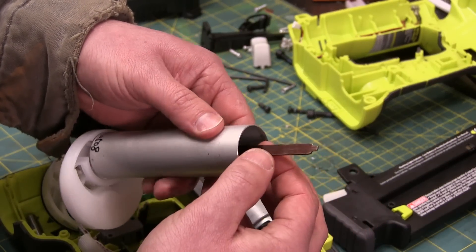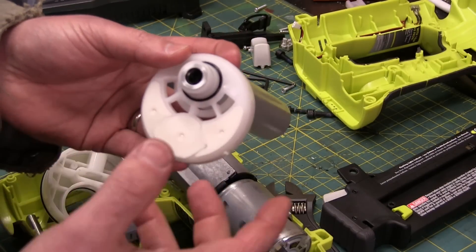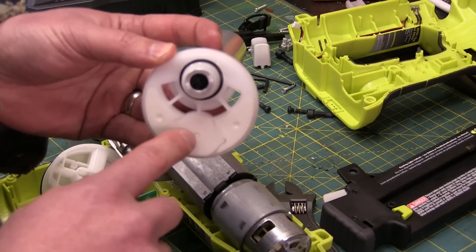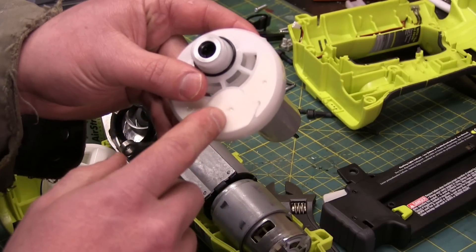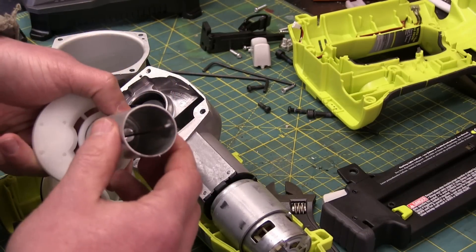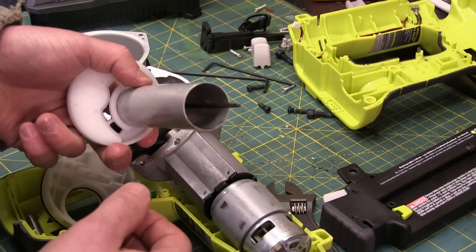Rod goes in - got pulled in by that magnet. So that's the detent. Now this is a mystery to me - why they would fill this with epoxy. I have no idea. Maybe this is a feature from another tool that they don't use, so they have to fill it full of epoxy. But it is a machine that's done this - it wasn't done by hand. You can see from these little fill pips here. This is just an extruded aluminum section here - not honed or anything, it's been anodized. So it's rough as shit. I'm going to wear out the O-ring in short order. But this is a home gamer tool - if you know that, you could fix that O-ring. No problem. O-rings are jelly bean parts, you can buy them off Alibaba.